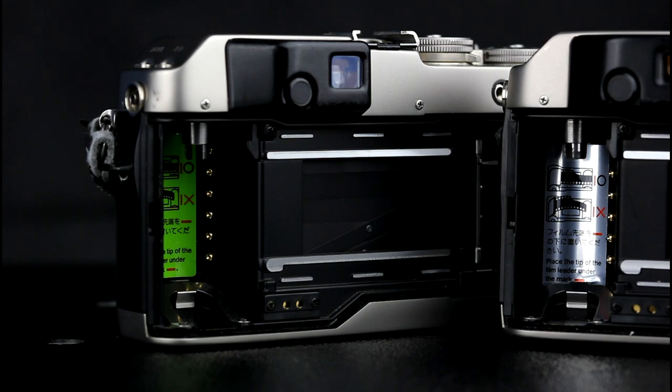There are some differences between the G1 and G2 in terms of the layout of the data. The location of the lens data seems the same, but there are some differences in the lens table parameters that are used between the G1 and G2, according to the respective factory service manuals. And the values supplied on the web do not match with the data I have read from the G1 green label that I have for the 21mm and 35mm lenses. So upgrading the lens data entries works, although I would suggest using numbers from an upgraded G1 rather than those from a G2. Other data, such as the autofocus adjustments, appear to be in different positions, and there are different numbers of autofocus data points in the G1 to the G2, and the calculation used is different.